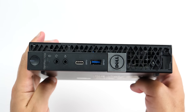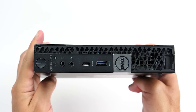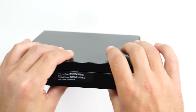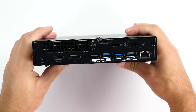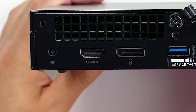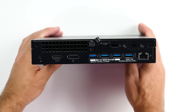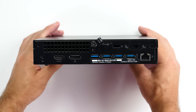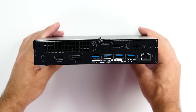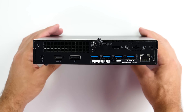Just remember not to buy the first mini PC you come across on eBay — since they get posted so frequently, there should be plenty to compare and choose from. Looking around the back, there are plenty of USB ports and, most importantly, an HDMI port. Some of these mini PCs only have DisplayPort out, so triple-check that there is some sort of HDMI out on the back. Otherwise, you'll need a DisplayPort to HDMI cable, and even then it can introduce some annoying compatibility issues with different TVs.